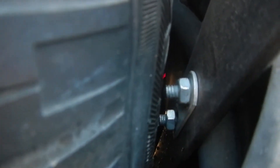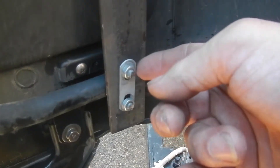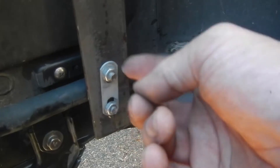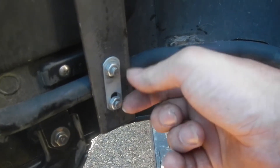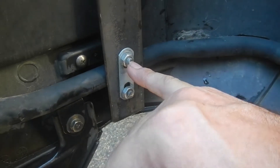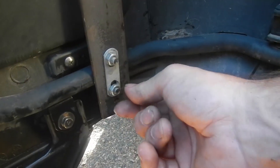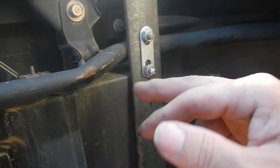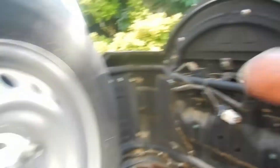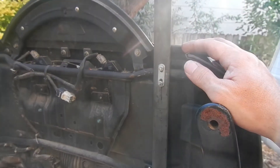So that's back up against the tyre — got plenty of clearance there. I think you can see the gap down at the bottom one there as well. When you're tightening up your bolts — I might be telling you how to suck eggs here — but if you just keep tightening one up, eventually this thing will come tight and you're going to have one of these bolts sticking right out here and the other one's going to be in there. So if this one's sitting out a little bit further than this one, what I can actually do is back this one off a little bit and tighten this one up, and I'll pull that one back in. We don't want one sticking all the way out and that one sitting all the way in, because it's going to be getting closer to that tyre. So we definitely need to make sure we had clearance, and at this stage we do.